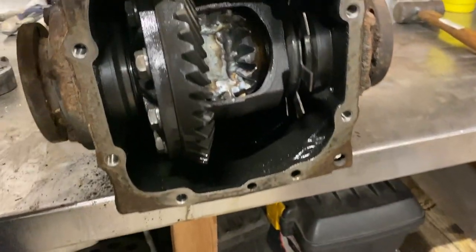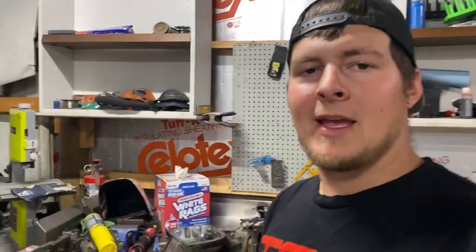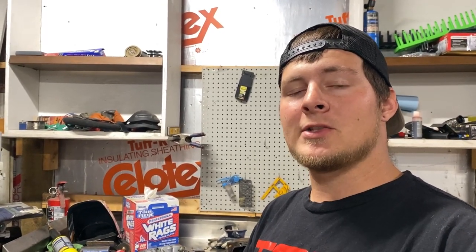Okay, so I got my spare diff welded. And when I say spare diff, I don't actually mean a spare to replace the one in the car if it breaks. I mean a spare diff ratio. So the one in the car is a 3.91, so it's got pretty short gears, and this one here is a 3.15. I always like to have at least two different gear ratios for options. If all you do is skid pad events where it's a really short layout and you can just do it in second gear the whole time, then you probably don't ever need options. But when my car had stock power, if you went from a skid pad to a big fast track, you'd have to do third gear, but it doesn't have enough power with the 3.15. So you put a 3.91 in to shorten third gear a little bit, and then the car has enough power to actually be able to spin third gear.